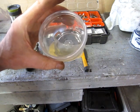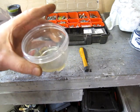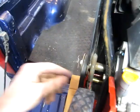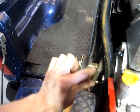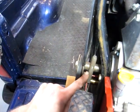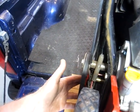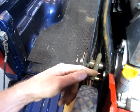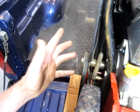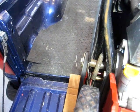There's still, I can't see any water in the bottom, no debris, so I think the carburetor system's pretty good. And just another comment, this idler spring, idler pulley that you pull on to make the paddles go round and round, it's spring loaded. So even if I got a belt that fit tighter on the pulley system, the spring is still going to only allow so much tension on it. Having said that, the belt looks in good shape. So I'm going to leave everything as is there.